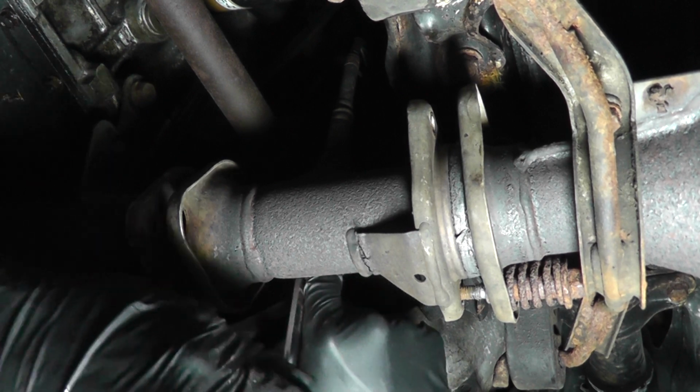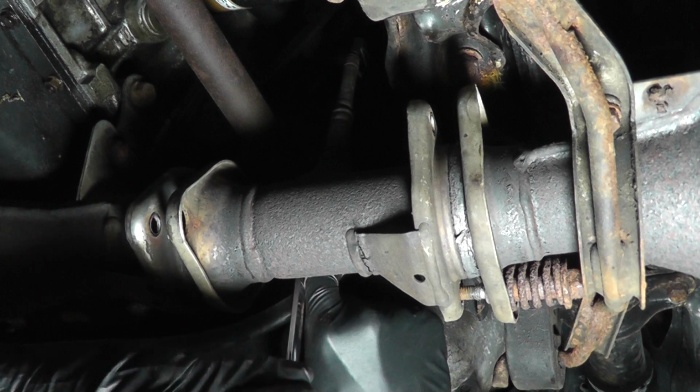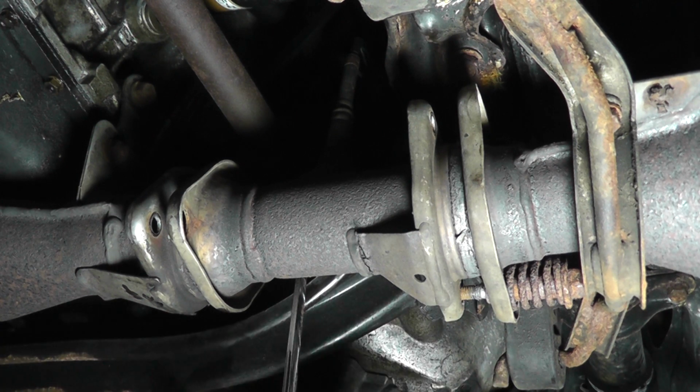Fun getting the wrench on up here. Now, if you have to cut this fastener out over here, you can see this beam's in the way, but it's easy to remove. 2 bolts up top, 3 on the bottom. I'll show you later, and this will come right down. I don't have to do that in this case, however.